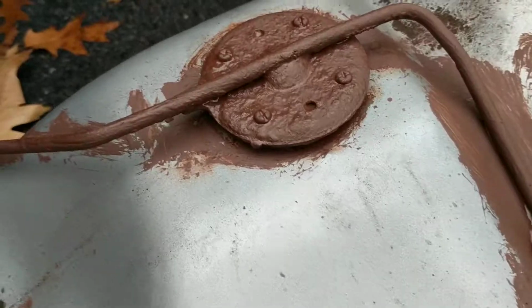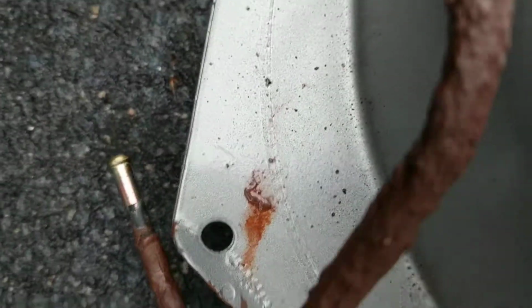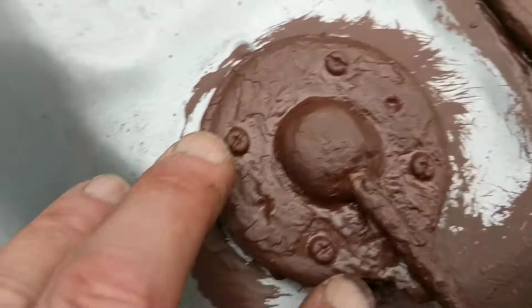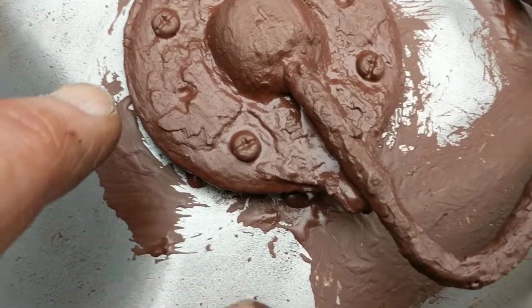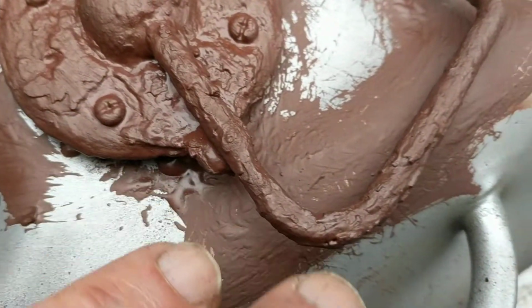Now, once I got them back on here, you can see I put the rusty metal primer on it, because this is the evap line. It, of course, had some significant rust on it, but it was still intact. It's not the smallest diameter line. It still seemed to be pretty good. So what I did was I cleaned it off with some solvent, dried it out, applied the rusty metal primer all over it. I do not, in a case like this, go after it with a wire brush or anything like that,